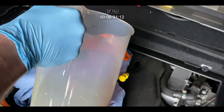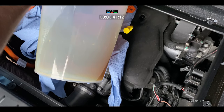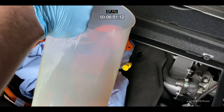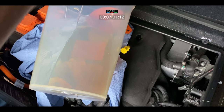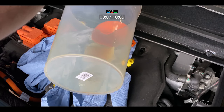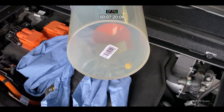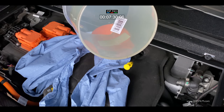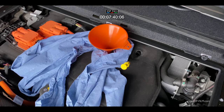When we've run it for five miles we're going to pull the dipstick out and check the oil level. BMW I think will charge 170 pounds to do this, and as you can see it's probably taken us 20 minutes max. At least we know what oil has come out and the quantity — BMW won't tell you what quantity of engine oil is in the engine, so this is a good video to show you how much oil is in the engine. 2,700 millilitres has gone back in. This car's only done a thousand miles, so it's worth doing the oil change.